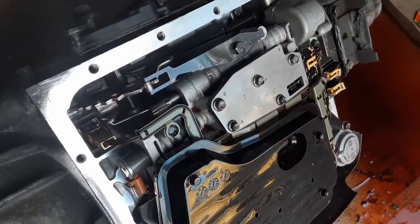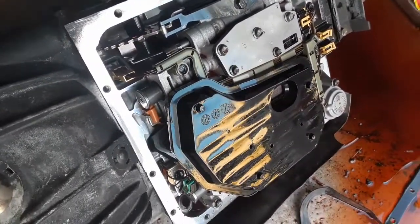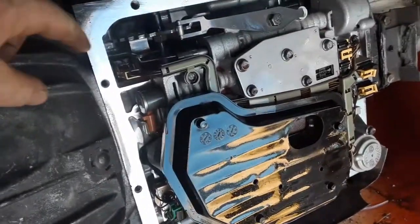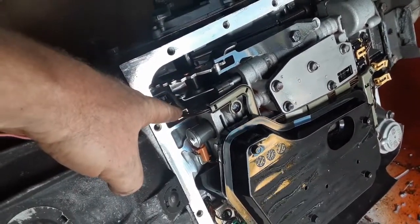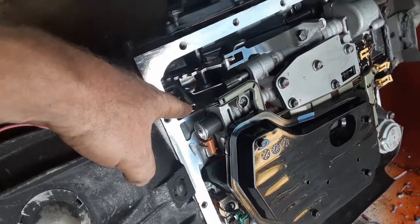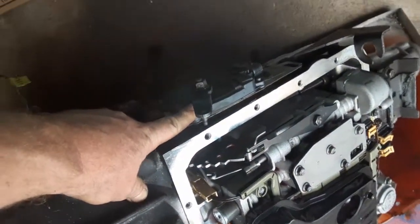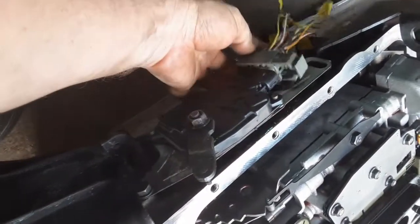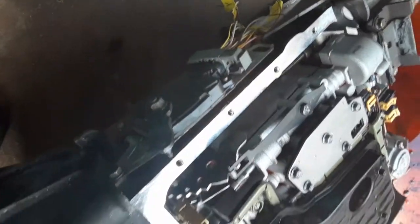So I took the pan off to fix the hole in it. Here's the inside, but there's one issue. Both of these transmissions — this is a 2008 — both have the internal speed sensor which started in 2007. The computer needs that. I don't feel like monkeying with it, but this one has the external neutral safety switch, so I've got the wiring for that. It goes on there — I'm going to splice that into my harness.